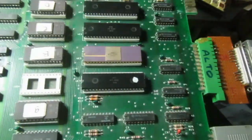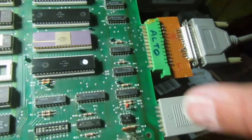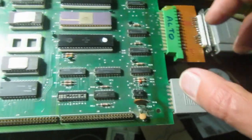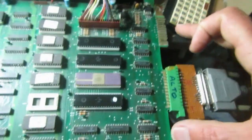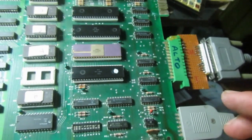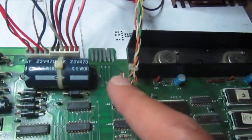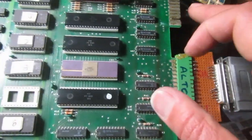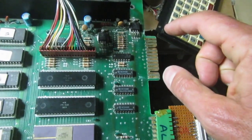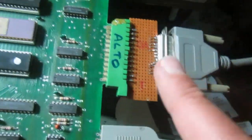As a final test I checked if everything works. I connected the keyboard and had to clean every edge connector because there was too much oxidation preventing the devices from working correctly. I tested both tape ports — this is tape 2 on this port. I also cleaned the keyboard, the IEEE-488 parallel interface, and the user port where I connected my parallel cable to transfer files with CBM Link.